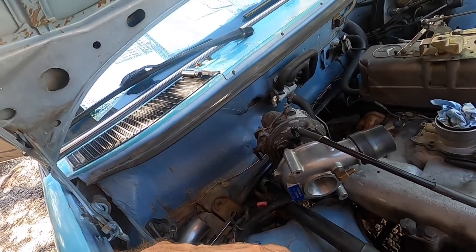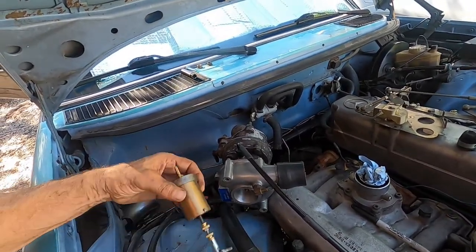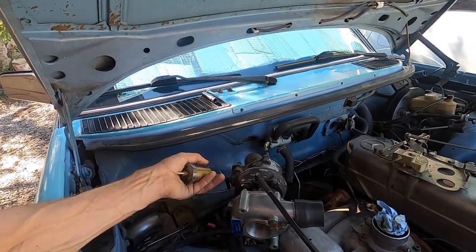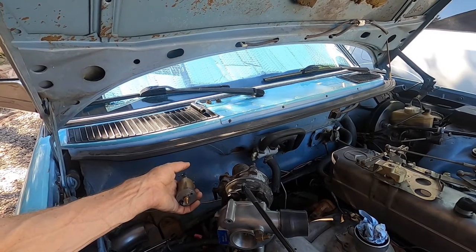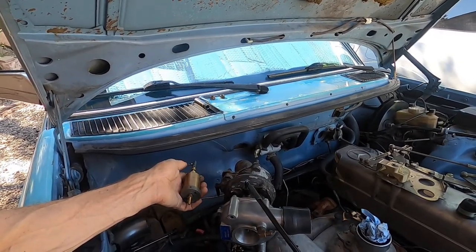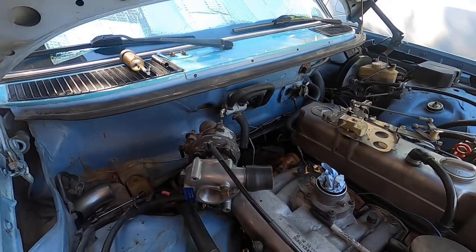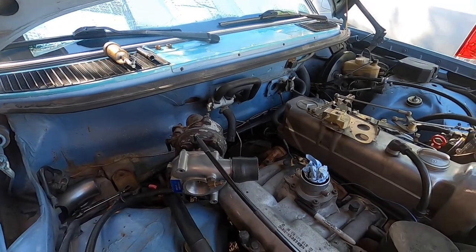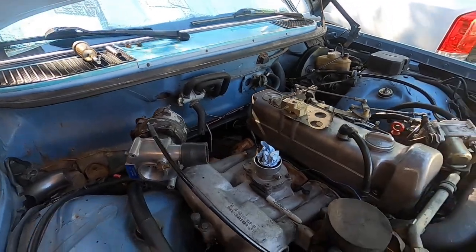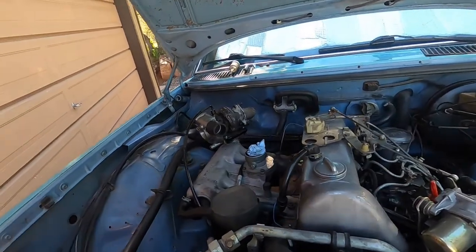Oiling, of course, yes, it does matter on the pistons, but I'm not hot rodding. So again, your heat is controlled based on your oiling, yes, but it's also based on what you're doing with it. Going up 10 is a lot in your effective compression ratio, which is where you're at. Granted, we drop quite a bit up here at my elevation. It takes 3 pounds at the gauge to meet stoichiometric at sea level, 14.7. But anyway, that's for another day.